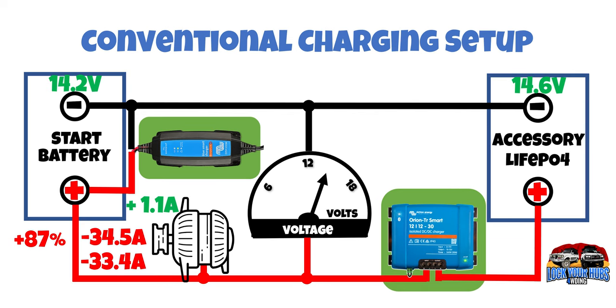Now I know there'll be some people screaming at their computer or mobile phone saying you've missed the obvious — you can just hook up an ignition wire to the input of the DC-DC charger. Now that will work in some scenarios but not all. If this is mounted up the other end of your caravan — and I'm looking at you Redarc for this one — their ignition sense wire on their latest chargers has its own low voltage cut-out. So if it's less than 12 volts your DC-DC doesn't operate. Unless you run welding cable from your ignition system right down to the back of your caravan, you probably won't get the thing to turn on anyway and you need to find an alternative.